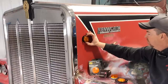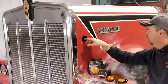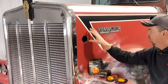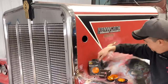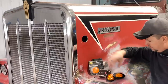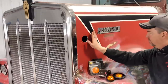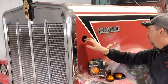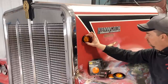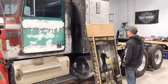The white-backed ones were used on the '73 and the black-backed ones were used on the '74. Since I'm doing this truck up like the '74, I'm going to go with the black ones. But now I need to unring this bell — repair those holes I cut in a previous episode. I found an old 900A fender just sitting in the ditch down the road, so I'll use the same hole saw to cut circle coupons, support them from behind, do fiberglass repair on both sides, sand smooth, and mount the proper lights.